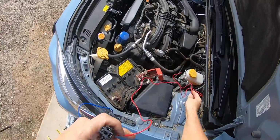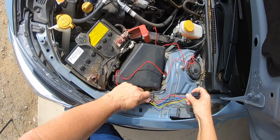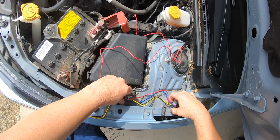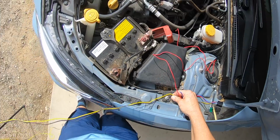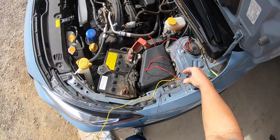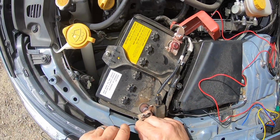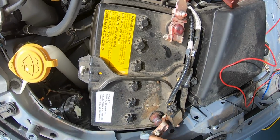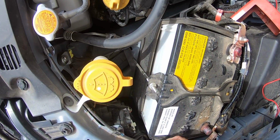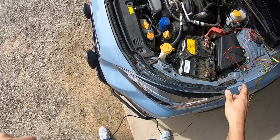And then from here, basically, you just take the wiring harness and start laying things out, figuring out where you want to put it. The red wire goes to the battery, as we talked about earlier. The black wire goes down to the Hella lights up front, and then the yellow wire is going to go to the switch. So just start putting things in the spot that you want them and figuring things out. It really helped me to do that, to get things started.